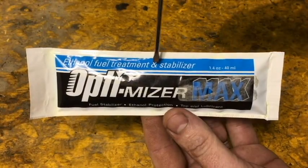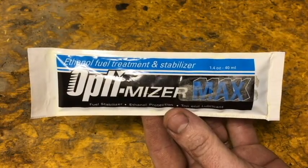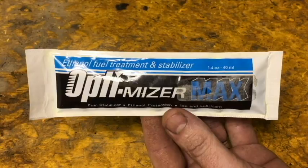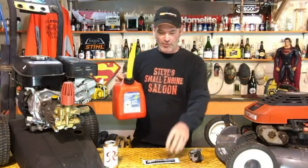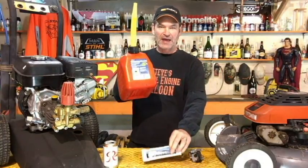Number one, the most important thing is fuel stabilizer. Fuel stabilizer comes in different quantities and different manufacturers, but if it says fuel stabilizer on it, go ahead and use it — that is the most important thing. Go get yourself some of that. Next, go to the fuel station right from the pump and get yourself some nice fresh new fuel. Follow the directions on the back of that fuel stabilizer, mix it into your fuel, and you have some nice fresh stabilized fuel.